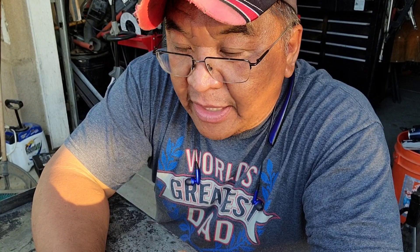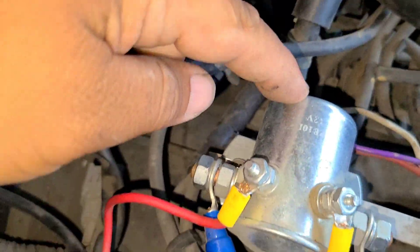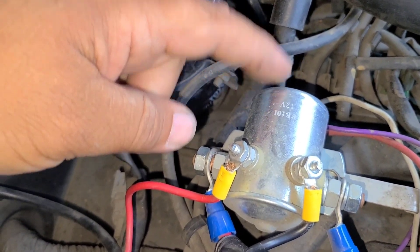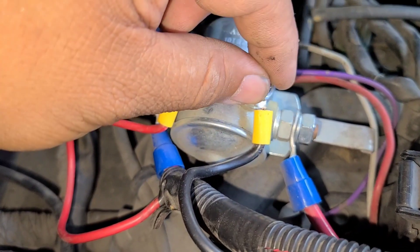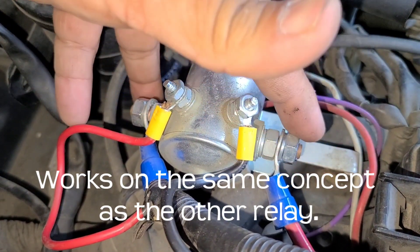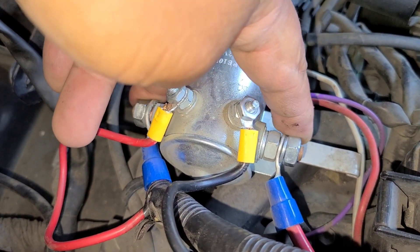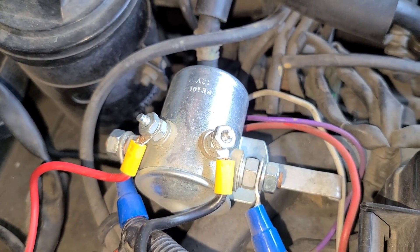I have a system installed in my Forerunner — Big Bertha — and this is what I'm getting from what I have. Here is a heavy-duty golf cart relay. These are used for golf carts that run on electricity. The positive line is red and the ground line is here. When these two are activated, electrical current passes through these two posts and energizes the coil, which connects the terminals and completes the connection, passing electricity onward. Basically a relay is like a gate — it closes and opens.